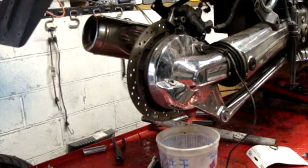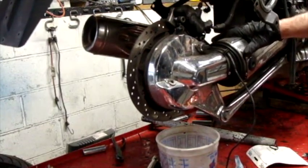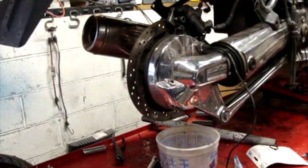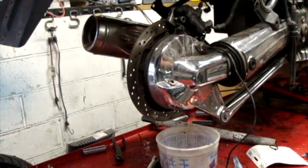So we're going to move on to removing the final drive. We have a couple bolts we need to take out. I'm going to pull this final drive and take a look at the splines. If they look like they've just been lubed up and it looks fine, then there's really no point in pulling everything off. I did check for play in this swing arm and there's no play at all, so I think the bearings are okay there. Off to a good start so far.